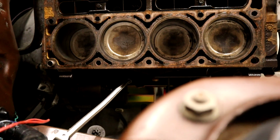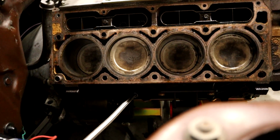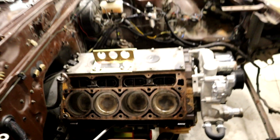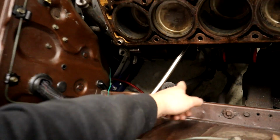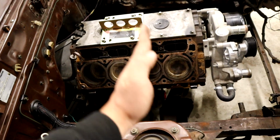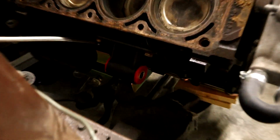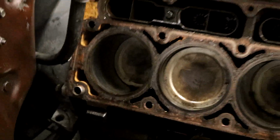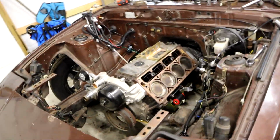Got this pig sitting back in the car. The oil pan looks a lot closer. I think I might still section it back like 2 inches or so. Right now the car is not quite full lock, but it's pretty darn steered because it swings on this axis right here. So the bar, like as you're steering it, swings like this. So I might section the oil pan just a little bit, cut it back to here or something and notch it, but looks like it'll work. Everything else is nice and clearanced.